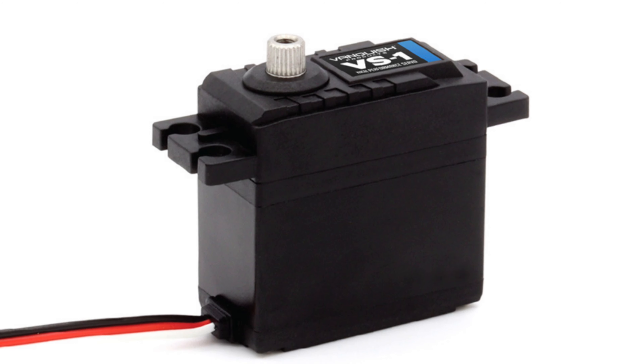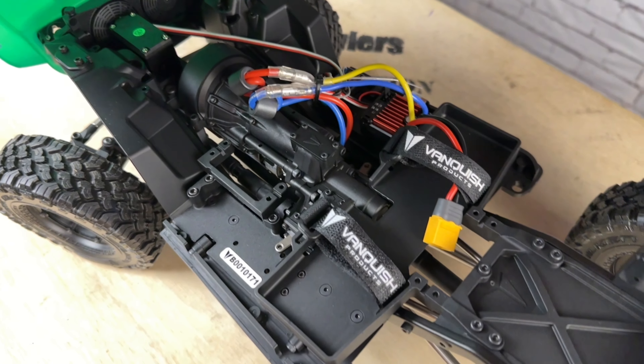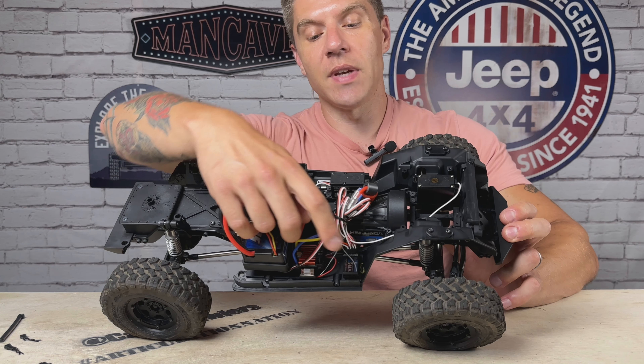Underneath, we've got heavy duty stainless steel links — these things are beefy and big and rugged. That carries through to the steering linkage as well and the panhard bar, which is also mounted to a machined aluminum panhard mount. We've got ISD-10 drive shafts. Most notably, we've got to talk about the axles — this is running the F10 portal axles, the composite versions, but still very strong. Just look at the trussing on these axles. The portal axles give you so much ground clearance — just incredible. This has an offset pumpkin in the front and centered in the rear. Inside the portals, you've got machined portal gears, machined ring and pinion gears with a chromoly 6-bolt spool at each end. We've got universal-style front axles giving this thing an impressive 47 degrees of steering, with built-in bump stops.